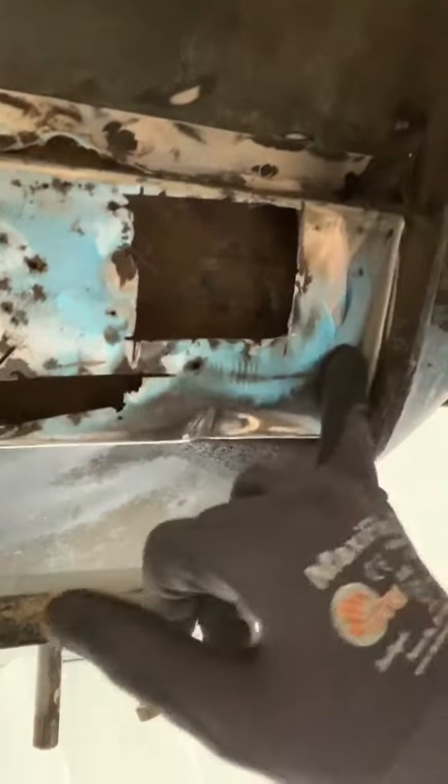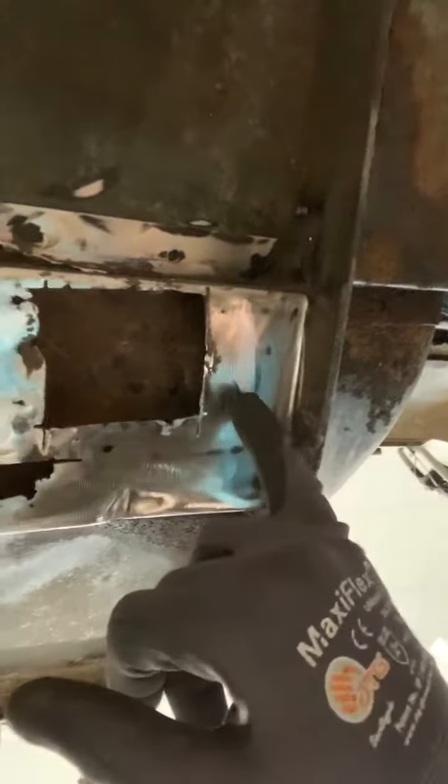We've ground back — if you can see the grain and cut, that is from a roll lock disc. This area here is just polished with the Scotch-Brite disc, and this is with the roll lock that has the heavier cut. I don't know if you can see that as I turn the camera a little bit. So what I'm going to do now is finish my prep, clean this up a little bit, get the cover panel I've made, prep the inside of it, and get it ready. Then we'll apply the panel bond.